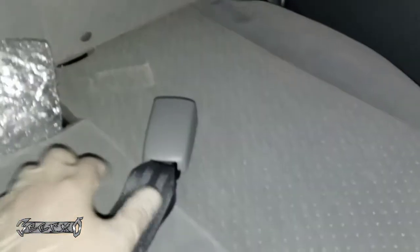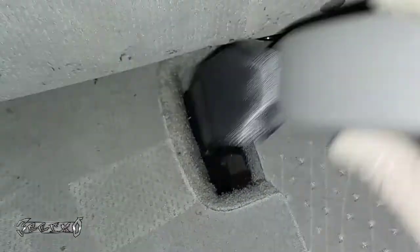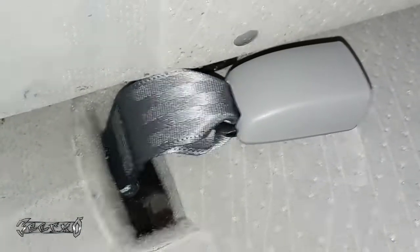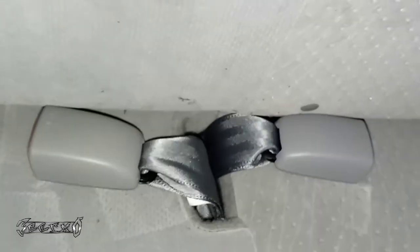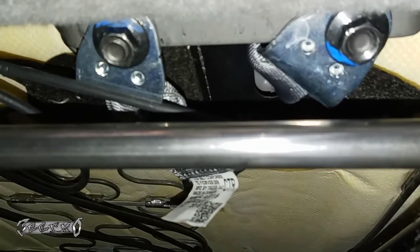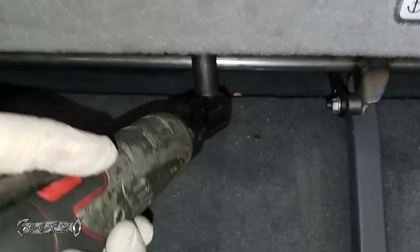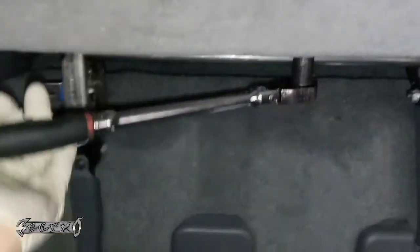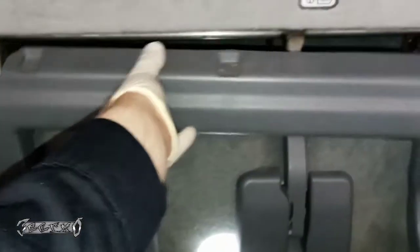That sticker was my part number. I got this from Toyota, the dealer. I'm gonna put this one in the back hole, and then this left-side seat belt goes here. This is the center one — as you see it says 'center' on it — I'm gonna put this in the front hole. Run them underneath and bolt them down, making sure they're facing the right way. Get them pretty tight — I don't have the torque spec, but I wouldn't break the bolt. This panel clips back on if you had taken it off — just make sure all your clips are in — and that's it.